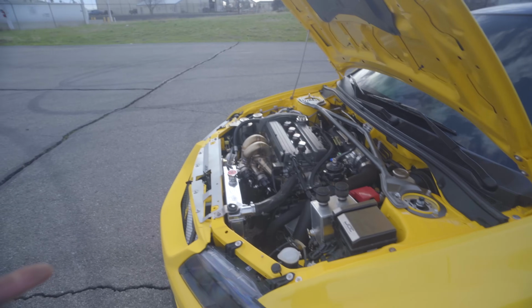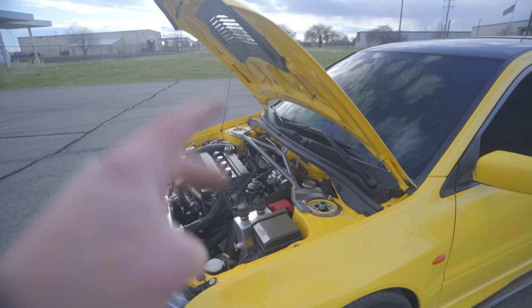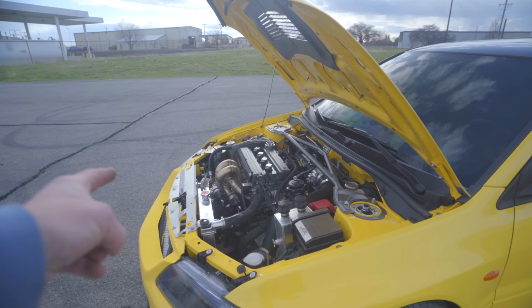Obviously, we need to get the car tuned. It's going on drive-by-wire and new fuel system before we get it tuned. Fuel system-wise, we're going from the FIC 1650s all the way up to a set of 2150s, from one Walbro 450 to 2, and then of course dash 6 and dash 8 feed and return, and that should be all the fuel that we need for this beautiful car. And then we're gonna get it tuned, and it'll be done. Officially done. I'll probably never touch it again because it will be absolutely perfect by that time.